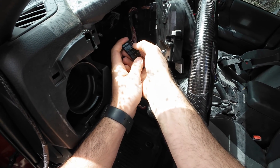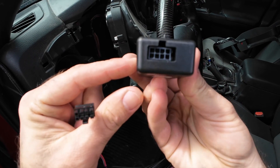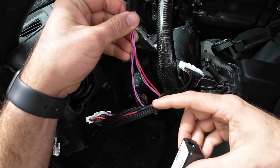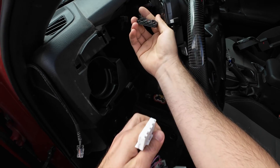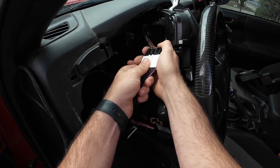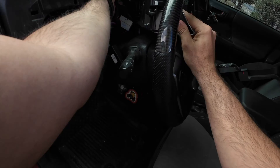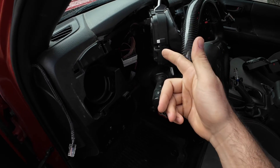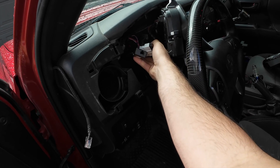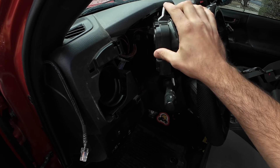There's just a little tab on the top of it. Press that with your thumb and this will pull out. On one end of the calibrator, you're going to have this port, which matches the wiring harness that comes off of the plug-and-play harness. The end that comes out of the back of the speedometer is a male plug. Plug that into the female end, and then we're going to take the other end and plug that back into the speedometer. Now with that plugged in, you just need to clean the wires up. Hypertech does include a couple of zip ties if you choose to use them. Try to tuck this away somewhere back in there so it won't interfere with the speedometer when you put that back in.